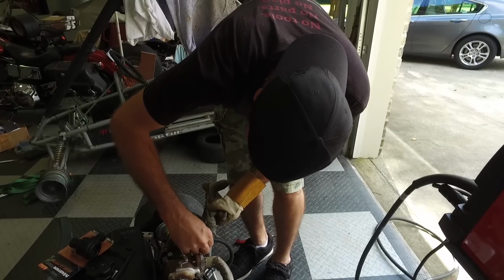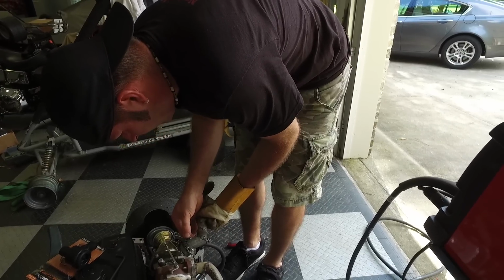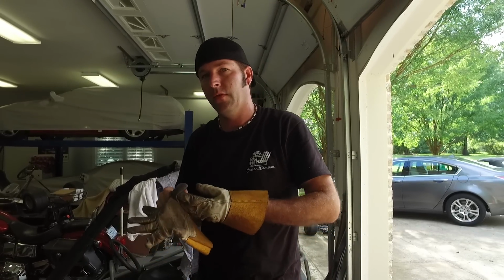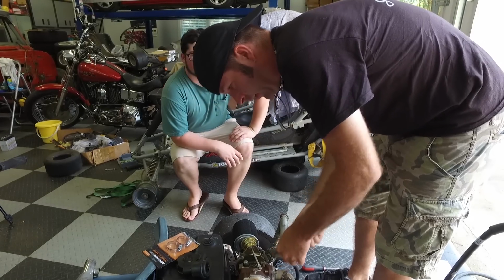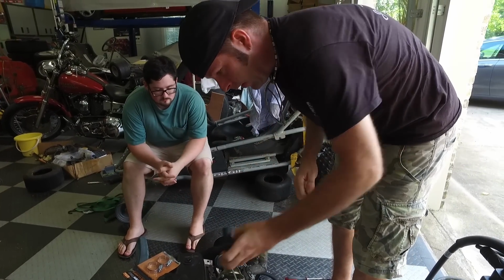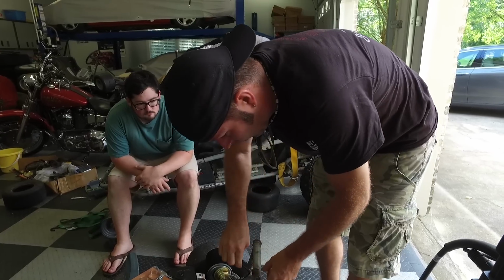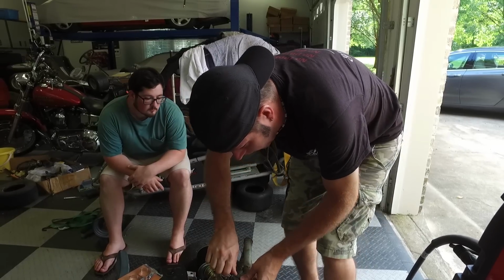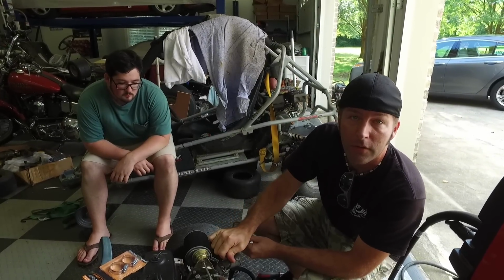Good. Well, I do know that we might not get all that we're expecting. I'm not expecting a huge... Yeah. Because the vacuum pulses are pulsy. Good steady vacuum is what we would need for a great working pop-off valve. I'm just hoping that we'll get something. If not, then it'll look cool. Yeah. These blow-off valves depend on vacuum to open. If we don't have a nice vacuum, we're not going to get a great result. But we're going to find out. Maybe when we let off the throttle, there's going to be enough vacuum from the engine dragging down to get a good psh.